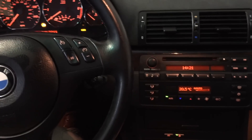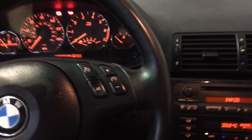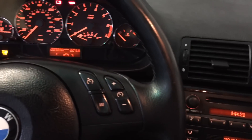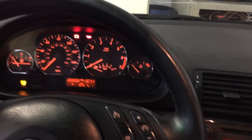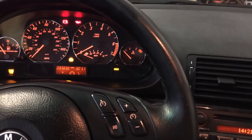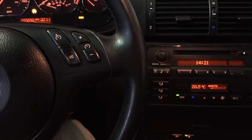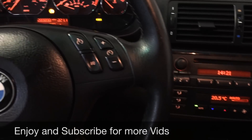I usually just leave them on, to be honest. Click it one more time and the systems all go back on again, which is the mode you want to be in since this is not a race car. You might get excited and want to do a little drift in the rain — fine — but just remember: first click is traction control off, hold for six seconds and that turns off stability control. Use this button wisely and with respect. Enjoy.